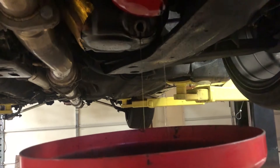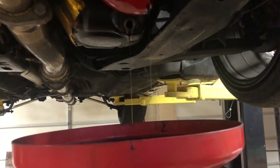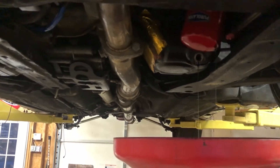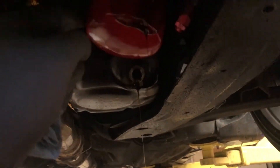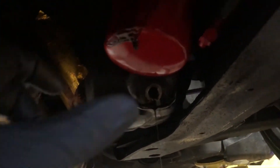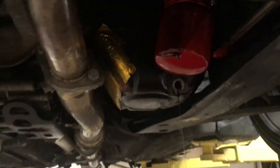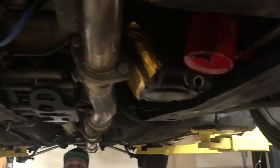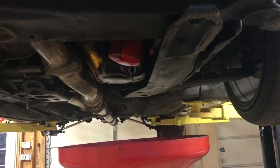Hitting the car with a quick oil change. I put oil in it before Florida and it smells like gas after the drift event like it usually does on this car. So I'm going to put some Rotella and some Pennzoil synthetic in here just for now. Once it starts getting hotter I'm going to switch back to Redline, which I normally run — the 20-50. Because for warmer climates, especially if you're on the track, the factory service manual actually calls for 20-50 for the turbo cars. So why not run it and have good oil pressure rather than worry about thinning out some 5-30 when it gets hot?